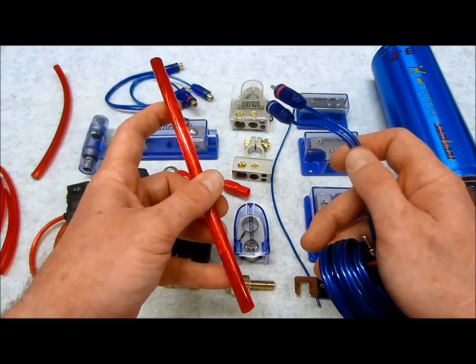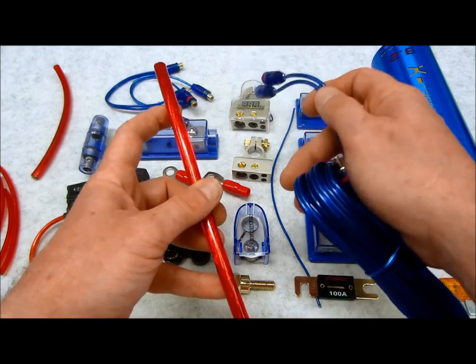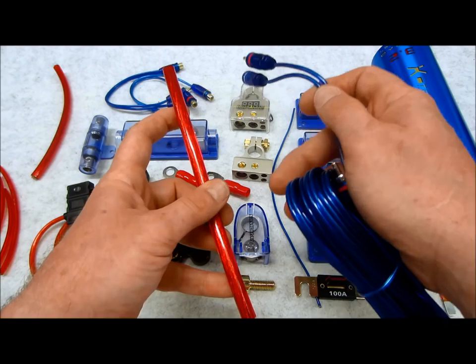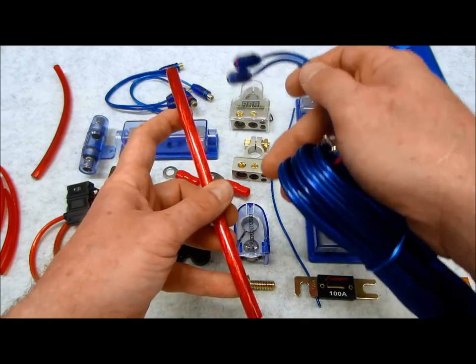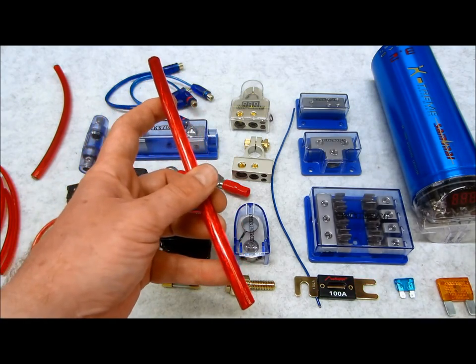These things will throw off some nasty noise, and these audio cables can always be very susceptible to picking it up, which is the audio signal going into your amplifier. So it's feeding the noise into the amplifier. The amplifier is in turn amplifying that noise, and out coming your speakers is this horrific noise.